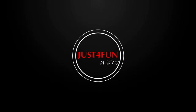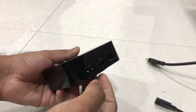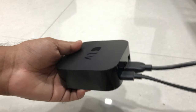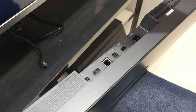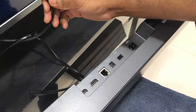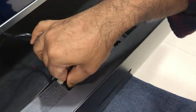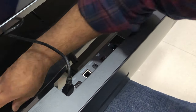Get a good quality HDMI cable that supports 2.0 and connect that to Apple TV. Once you are done with that, connect the output of Apple TV to the input of the JBL 9.1 — take the HDMI and connect that to the input of the JBL 9.1.